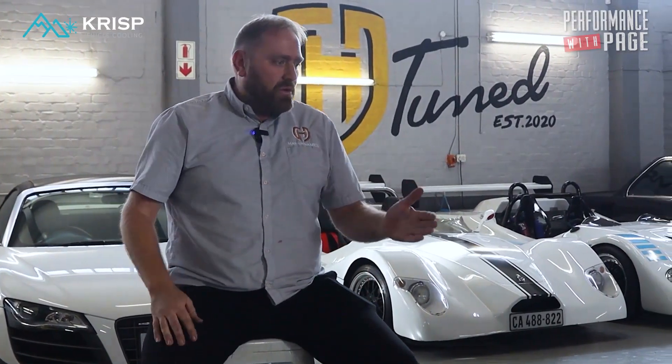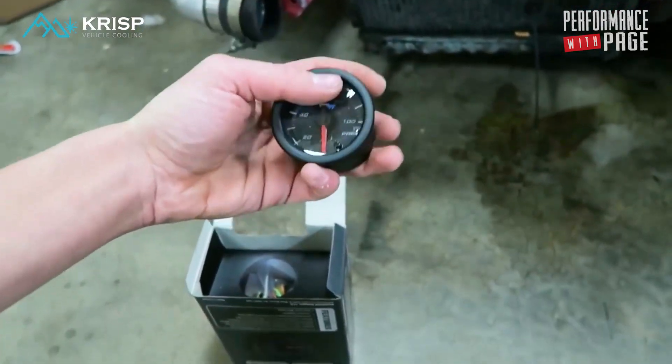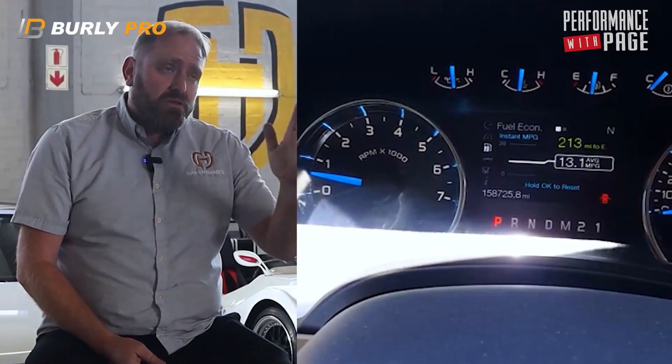You can also have your oils tested. These engines come from wherever, guys stick them in and rev them with no oil pressure gauge — no idea what the oil pressure is. If they had a gauge on the dyno and saw 2.8 bar at high RPM, stop the bus, there's a problem. All you need is a mechanical oil pressure gauge in the car so you can monitor your oil pressure, and the minute it starts dropping while you're revving, you need to ask why. A guy waiting for it to get to half a bar is going to have a conrod come out.